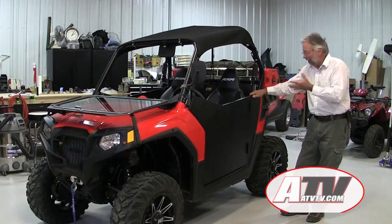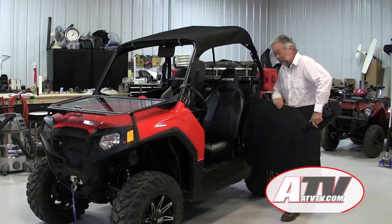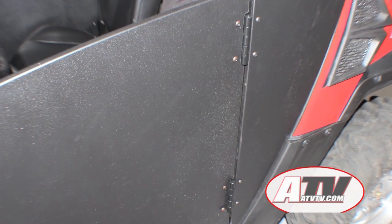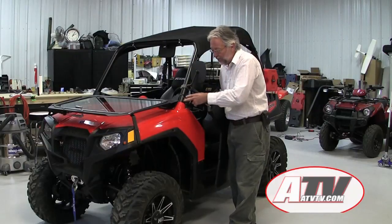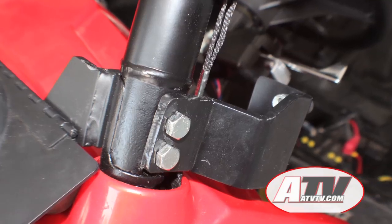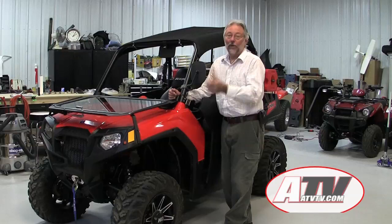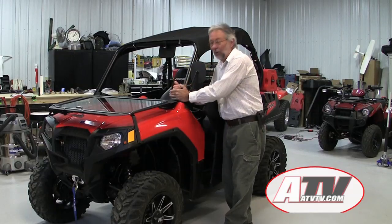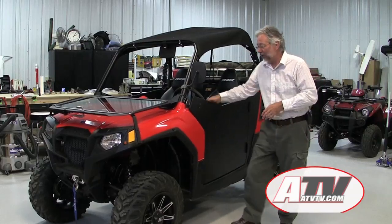You remove the three bolts for the roll cage — actually remove the front two bolts and just loosen the tough one underneath — and the whole piece slides in. Tighten everything down and that's what gives this door its solid feel. Once you get that part done and mount the hinges, you still have all of the solidness. Then move to the front and put on the latch mechanism, which attaches to the front roll bar. They supply longer bolts since it just replaces the two bolts that hold the two halves of the roll cage together. If you've already got something like a Right Fab folding windshield, you've already used those longer bolts, so you'll need to get even longer ones — a trip to the hardware store and about 70 cents a bolt later you get a half-inch longer bolt that fastens both things together.